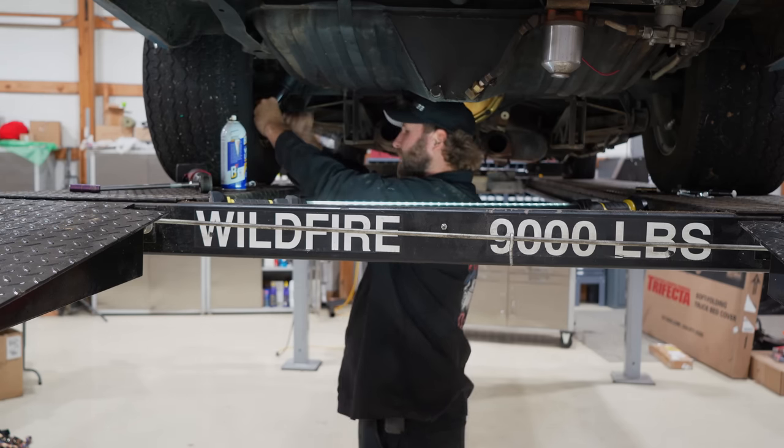Having some sort of issue with the transmission. I think it's a manual valve body. I thought I was in third. We may not be getting first out of this gate. Is there a way I can progressively do this shifting and stay in the throttle? Yeah, you can stay in the throttle. Normally if you have a speedo, keep going until you're around 45, then we know you're in third, and then we get to 2000. I might have to go 3,500. You probably have to really wind it out so we know you're in third, then let it back down to 2000 so we can do the calibration. Okay, all right, we're trying it again. Here we go. We'll do 2800 to like 4,500.